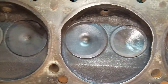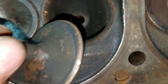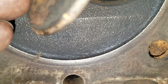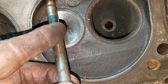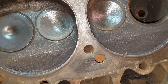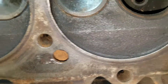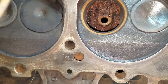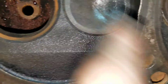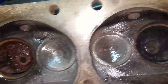The chambers have an interesting shape. Pulling the valve out - I kind of want to say this thing had a valve job and probably would have been just fine had it not gotten water on it, because it got down the guides. This one was stuck in there a little bit - give it the old dead blow hammer. So it probably would have been a usable head if it didn't sit and go to shit. There's all the water that got in this. It was a touched head - as in it's been fiddled with, a valve job or something.